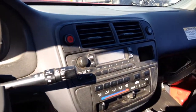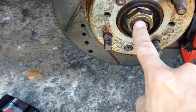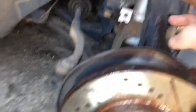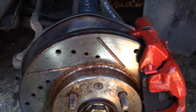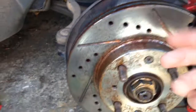We're running into some problems — I cannot get this bolt off at all, it's completely seized. I've heated it and done everything I could think of. So we have a pry bar and we're gonna pull the whole axle out and just replace the whole thing. It'll be easier to do that than to keep fighting it. I bought an axle so I'm gonna pull the rotor, brakes, everything and get it ready.